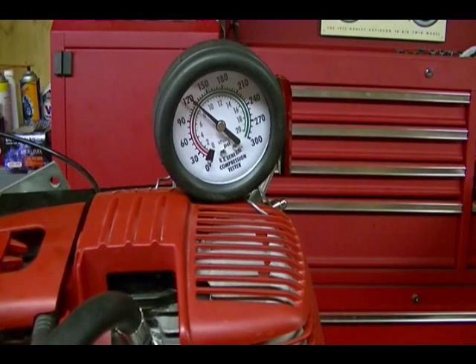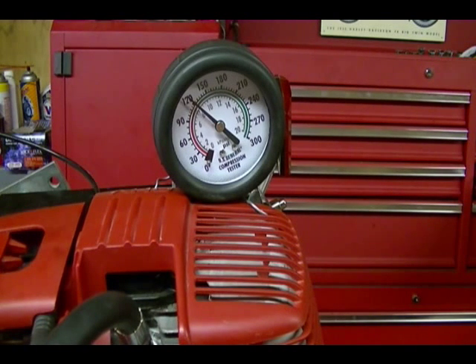Just to summarize: in the first compression test with the throttle completely closed I got a reading close to about 70 PSI, and in the second compression test with the throttle completely open I got a reading of about 125 PSI. Just from the throttle position being closed or open it gave me a difference of 55 PSI. So it just goes to show you that when you're doing a compression test on a gas engine, you should always have the throttle completely open, because if you leave it closed you're not going to let enough air into the engine to give you an accurate reading. Hope you enjoyed the video and thanks for watching.